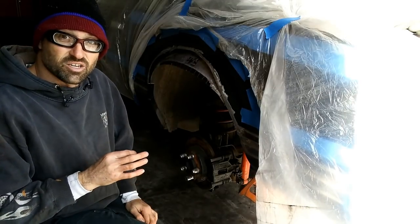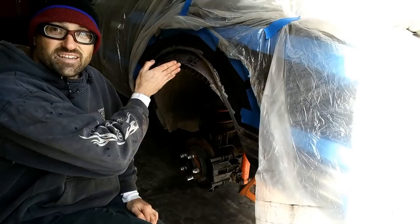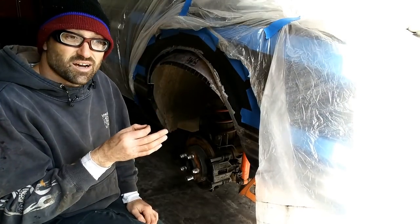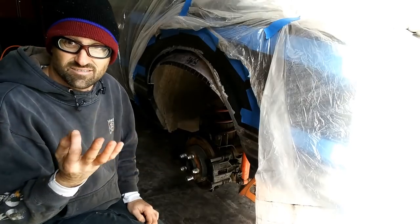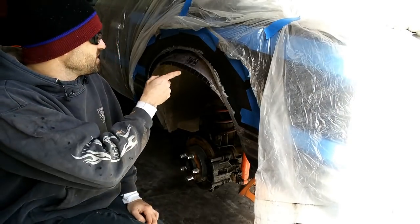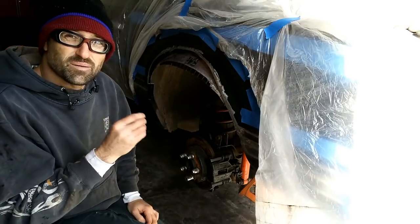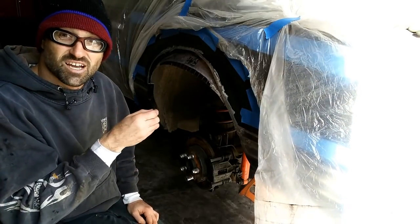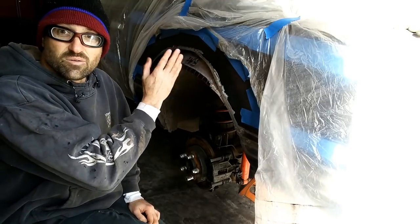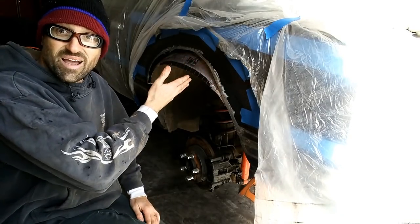So the next piece I need to do is, obviously I've marked here and I need to cut my 1-inch pie cuts. Now an inch, I actually saw it on the internet, and of course it actually did work. So I would say roughly an inch, kind of. And one thing I'm doing on this one versus the other side is that I didn't grind while everything was together, I guess, before I pie cut.